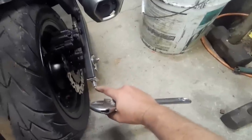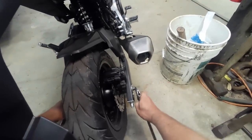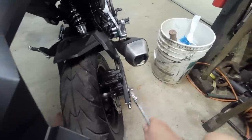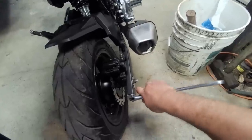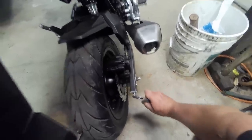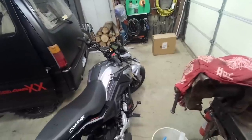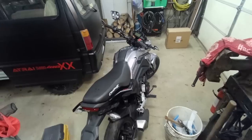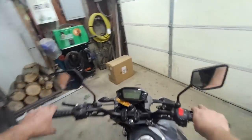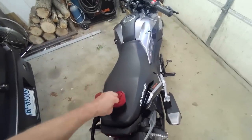I typically don't go off the length of these, but I'm going to try it. Just a nut and lock nut. A lot of you mentioned I should put an air pod filter on there, leave the jetting and then end up putting the pipes. I think I might end up doing that because I'll probably have to go up to 100, so the 100 main jet should be good.